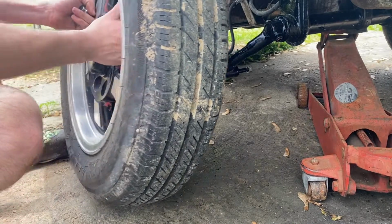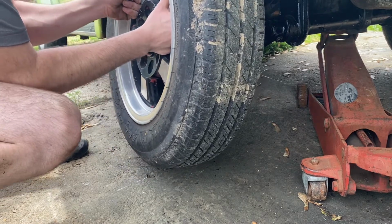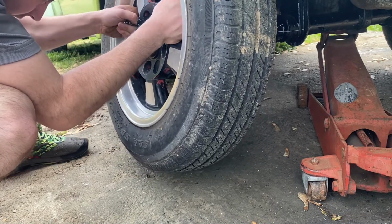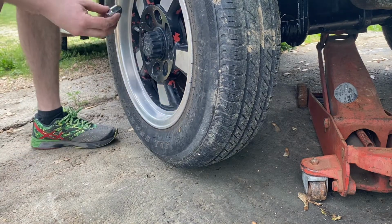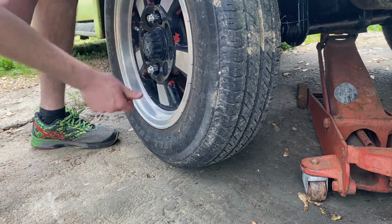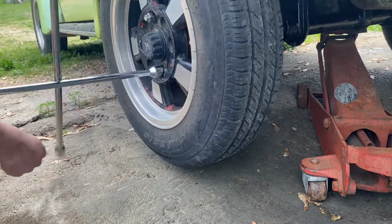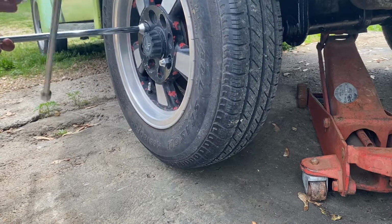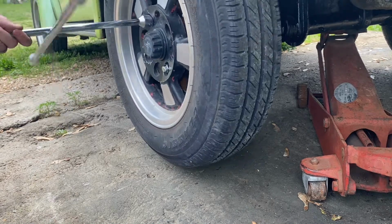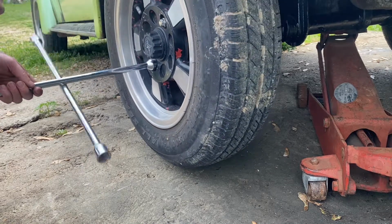Okay, in the next part, you're going to see that I lower the car to test the ride height of the suspension. What I ended up doing was I accidentally didn't tighten the set nut on the beam tight enough. So whenever I lowered the car, you can see that it pops and the car goes lower than intended. I loosened the nut back up a little more, jacked the car back up in the air like I did the first time, and set the ride height the exact same way, except this time I tightened the nut a bit tighter. Once I lowered it back down to the ground again, it ended up being almost exactly the perfect height for what I was wanting. So the car ended up sitting really great on the fitment.